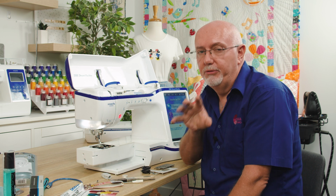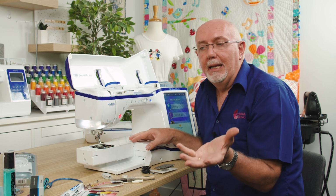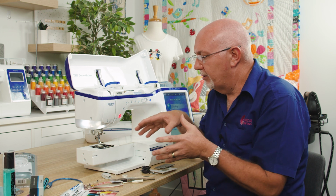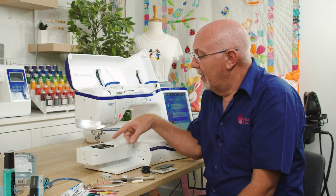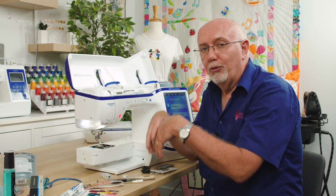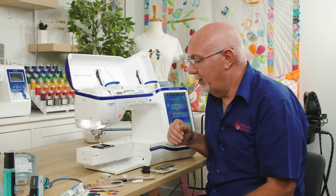So I personally do not recommend using the cans of spray air on a home style machine. If you own a PR series machine, like the industrial type machines, it's no big deal because you don't have that mechanism to blow things back into. You can use a compressor or spray air. And of course, when we service these machines in a workshop, we have all the covers off, everything is stripped down, so we do use a compressor and it works great for us, but you don't have that benefit in the home.